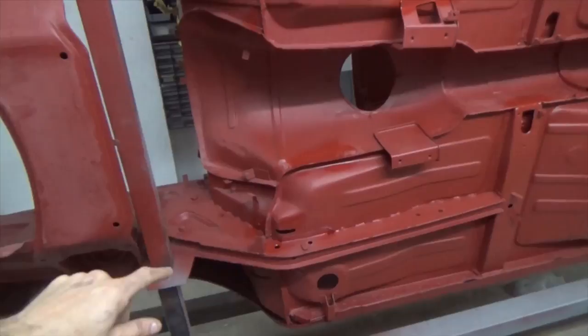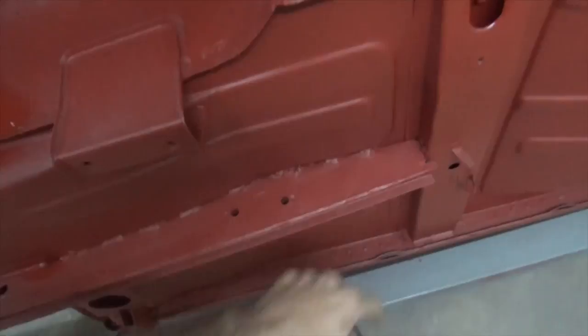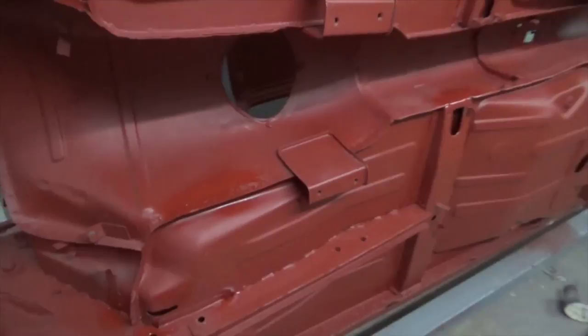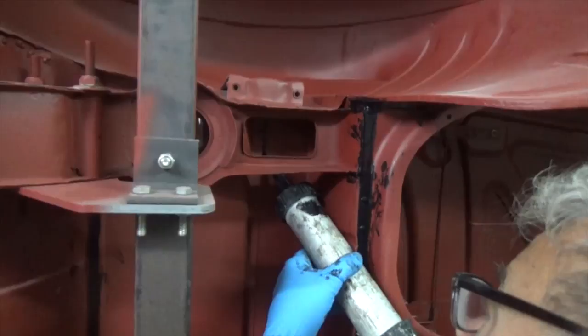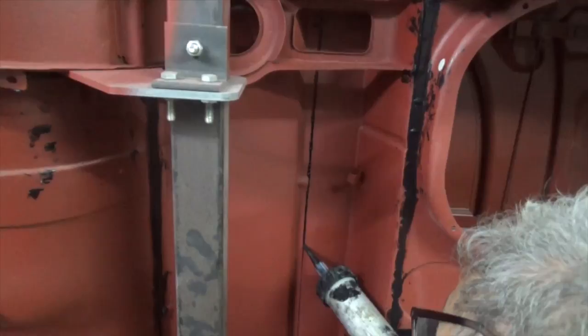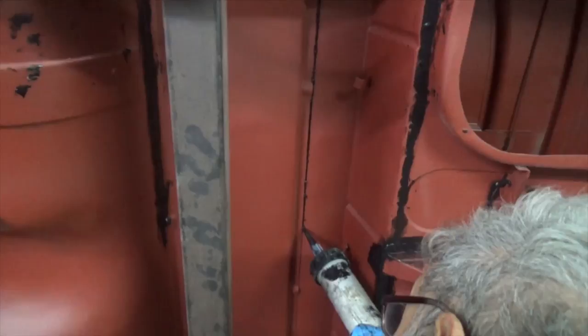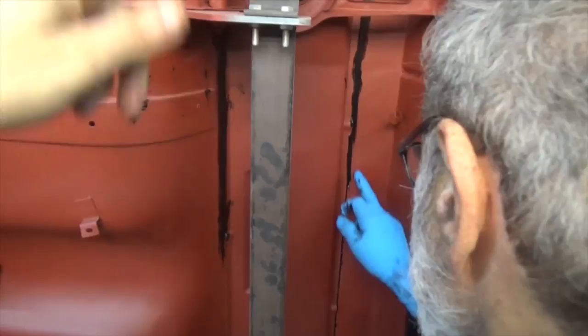So after trying some parts like seats and the pedals, we had to drill some extra holes and we covered them in primer. So now the next stage is to seal all the joints where the panels meet, like these. So we're going to take some seam sealer, adapted for metal, and just go all over the joints. After applying the sealer from the tube, we're just smudging it with our finger, and it's very important to wear gloves for this job.